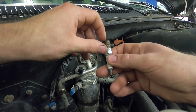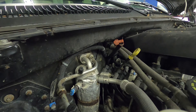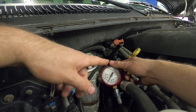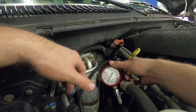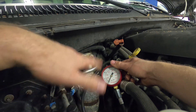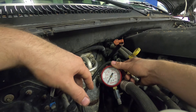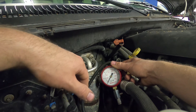I didn't notice that until just now while making this video. My next step was to run a compression test on it, so I threaded my compression tester in, cranked the motor over, and disconnected the fuel pump relay so it would crank and not start. We had a little over 150 psi on this cylinder, which is honestly not the greatest on a modern engine, but it's within a range I'm not worried about. It's got enough compression that it should be contributing — and it's not.